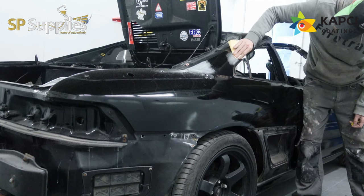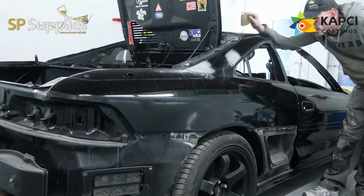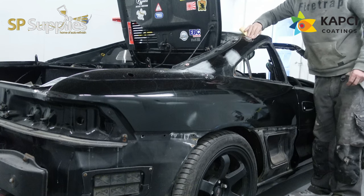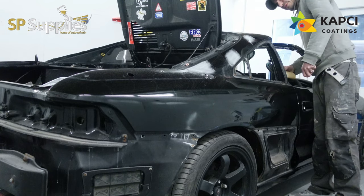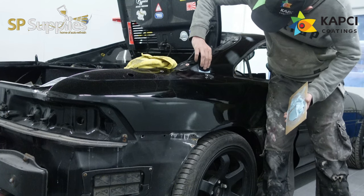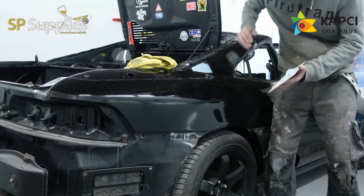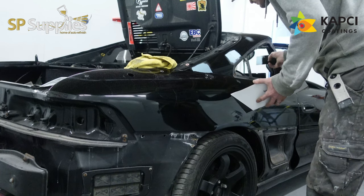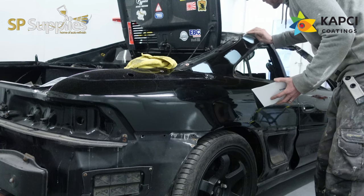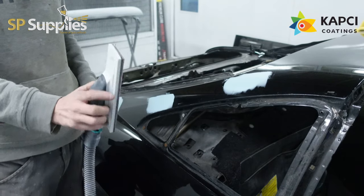The filler I prefer to use is the Upol Dolphin Premium — the medium depth one. I don't really find a need for the deep repair one because with the GYS system we can pull everything out to more than close enough that you can just use the medium. We've also got the Kiko system coming in. We don't need to be putting an absolute ton of filler in — it's just enough to reshape that part of the panel. These are very light, almost like parking dings up this pillar — maybe it's where someone's been leaning over trying to work on the engine. Overall the car is pretty good.